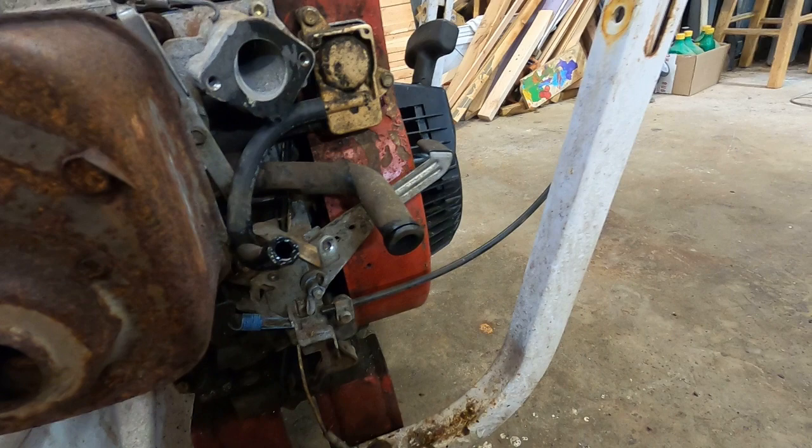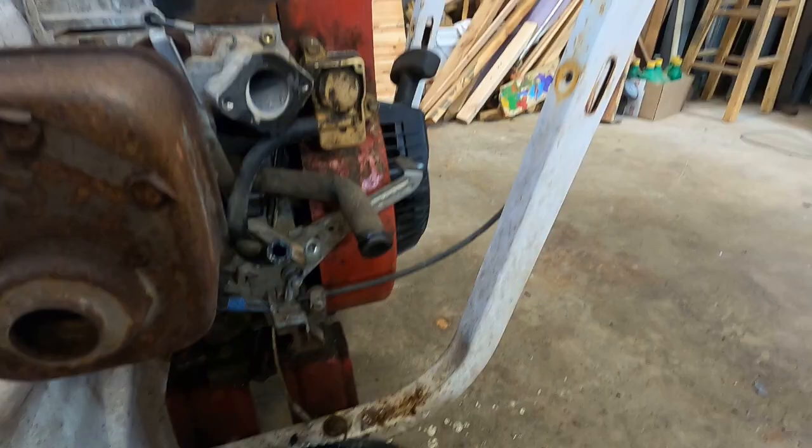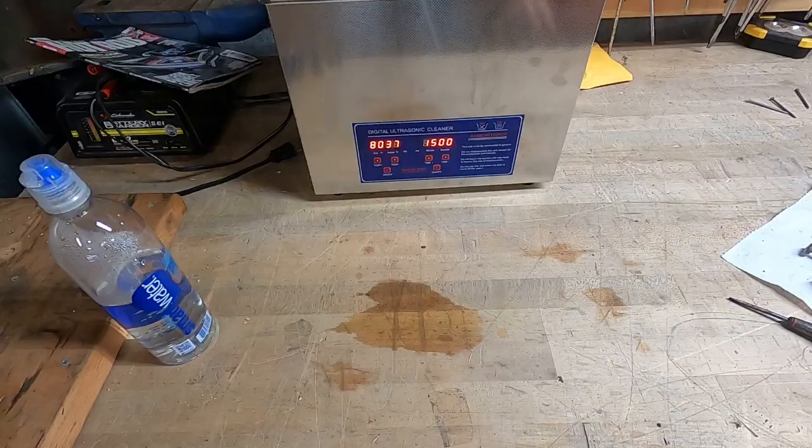So I'm actually gonna go and pull this over a couple more times, try to clear out that whole, oh, I need to drain the tank still, don't I? It's pulling that crappy fuel from the tank. Amateur hour. All right, let me drain the tank while the swarm of locust machine is doing what it does. I'll drain all that fuel out. That confirms, we know what the problem is. Ethanol gas, she done went bad. Story old as time.